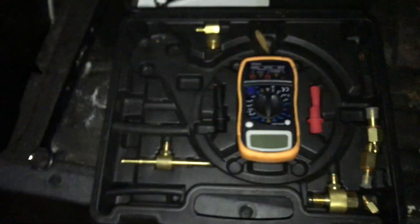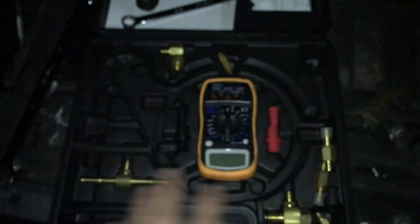It's not the 65 I thought I had before — that was what the pump is capable of when hooked up to the return line and blocking return flow. So this is actually good news because it's telling me my pressure regulator is good.